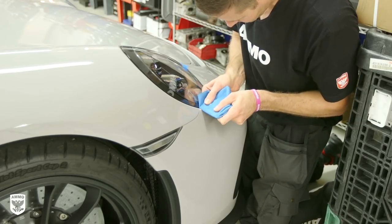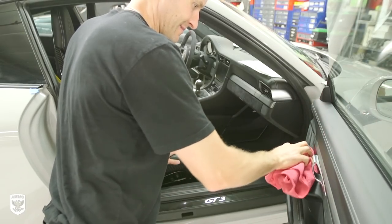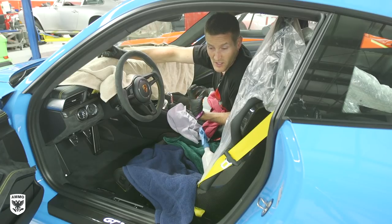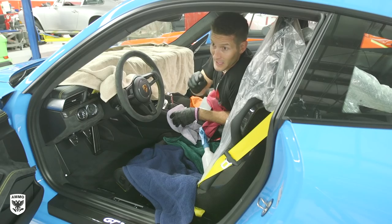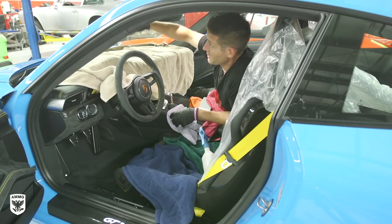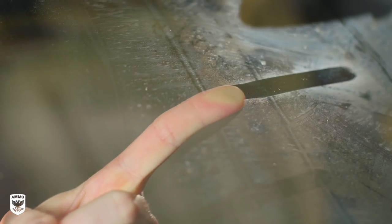I vacuumed the carpets and seat, touched up the interior plastics with ammo lather, and added some Scotchgard to the carpets since no rubber mats are being used. New cars in particular have plastic that gasses out — these are called plasticizers. They release from the plastic dashboards or the leather and get stuck to the glass. That's the new car smell you smell — that gas raises up and sticks to the windshield. That's that yellowy film you see all the time — super annoying. The purpose today is to minimize that for the new owner. If you put it in the sun it'll actually make it worse faster, so that's a little FYI.